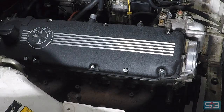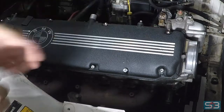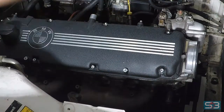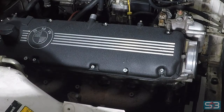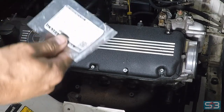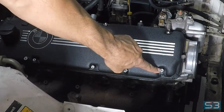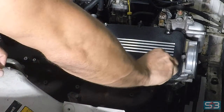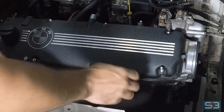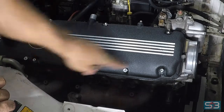Before I start putting everything back together, I want to explain how I'm going to mount the coil packs and the bracket. The original cam cover bolts were acorn nuts because the studs are built into the head and come through. For these bottom four studs, I got some M6 standoffs — 18mm, M6 by 1. So I'm using these as my bolts to hold on the cam cover, but they also give me a recess to screw in my coil pack bracket. That's how I'll get the bracket installed using the existing studs with these threaded standoffs.